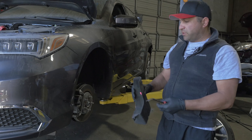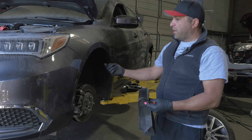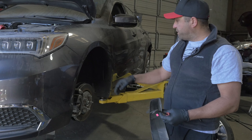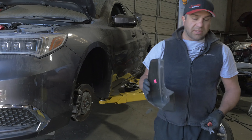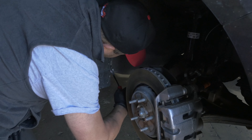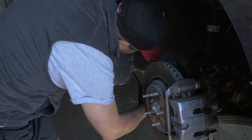The reason why I'm taking this off first is I want to get the liners off, because the screws underneath the bumper are easier to access. So that's how this comes off. On the right side of the fender, there's a clip right here — just stick your little tool behind it.